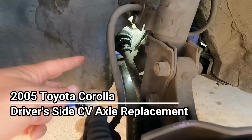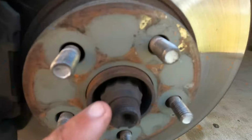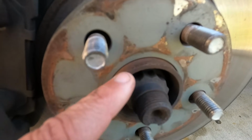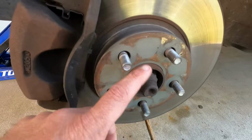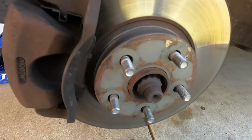I'm going to show you how to change the front driver's side CV shaft or CV axle on a 2005 Toyota Corolla. Now just note that you will need a 12 point 30mm socket before you do this job. I'll put a link to one in the description, but you might be able to rent one from your local auto parts store or pick one up locally as well.